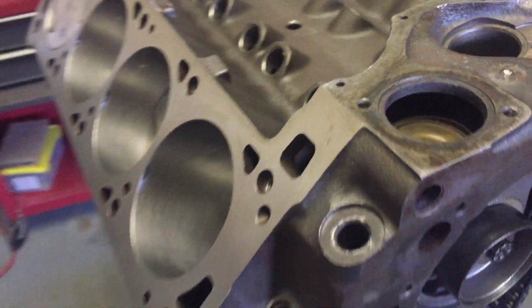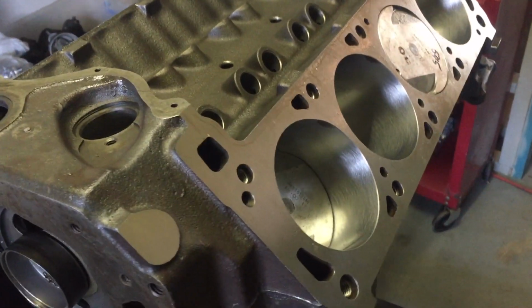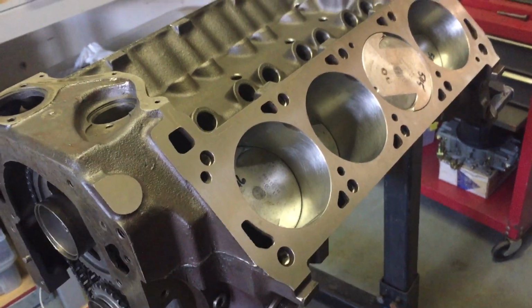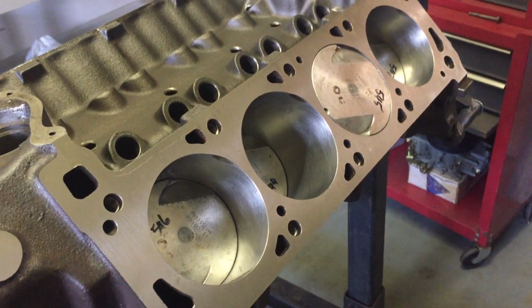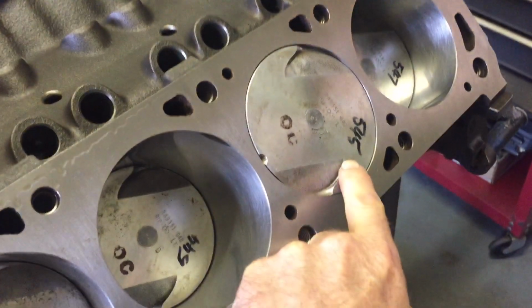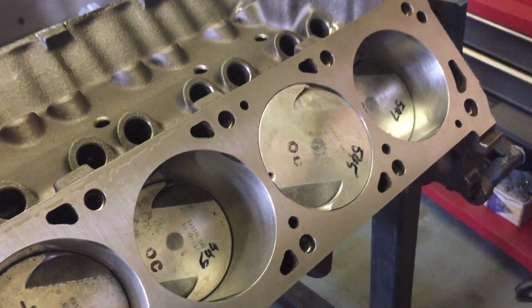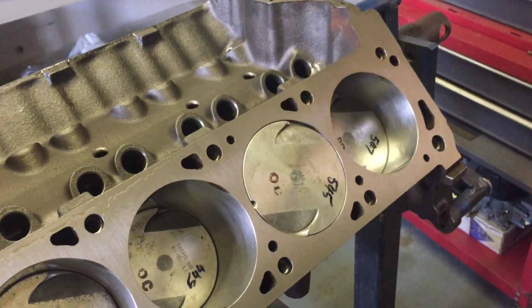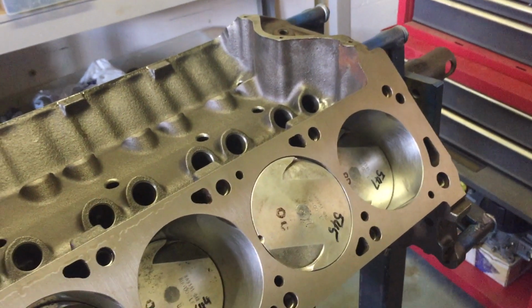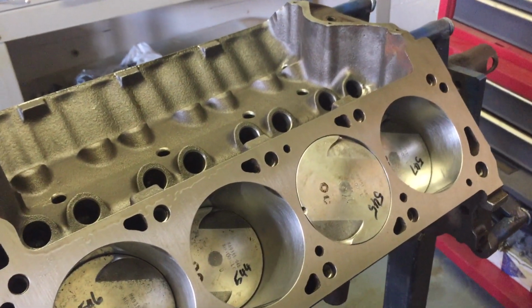Now, going back to the beginning when I suggested that there were two things that I wanted to bring up with you, and that is the piston to deck height that Ford had on the Phase 3. Generally, the standard engines that came out from the factory, the 4 barrels, had approximately between maybe 25 and 30 thousandths of an inch of deck clearance between the top of the piston and the deck of the block. And so that allowed for lots of variations in conrod length, piston pin height, machining tolerances of the block, of the deck height. There could be an accumulation of clearances that when it's stacked up, the piston could be somewhere between 20 and 30 thou from the deck.